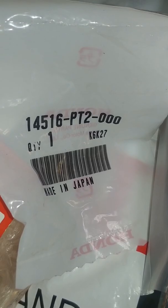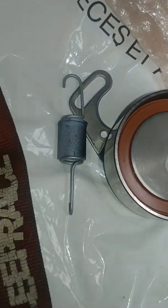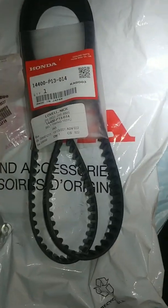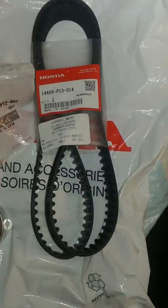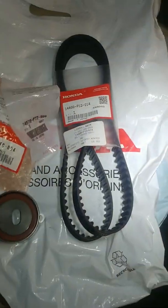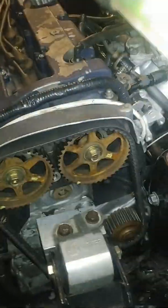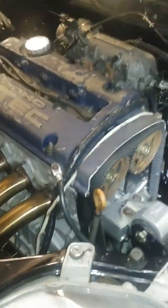And then this is the spring here. A lot of guys don't run the spring but I like to just keep it there — you still got to pull out and tighten and whatnot. So this belt here is for an H22, this is H23 VTEC, but it's going to have the same tooth count. It still runs the same water pump teeth and that's the main thing. The bottom cog is the same, the cam gears are the same, so basically it's all in the tensioner.